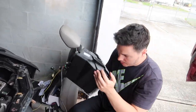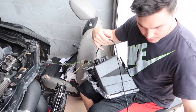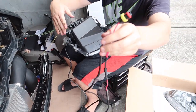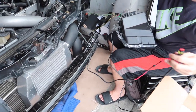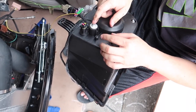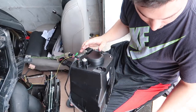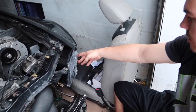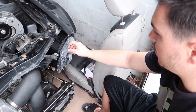I went ahead and plugged this side up. The longer cable obviously goes to the far side because it has to reach all the way over there, and the shorter cable goes to the fuse box on this side — it runs like an L-shape. To adjust the headlight, you turn this screw and it adjusts the LED up or down. From factory it should be ready to go. Now it's time to put her in. We got this headlight in — just got to put those two bottom bolts in, then take the wrapper off. I really don't want to scratch the headlight.